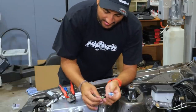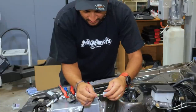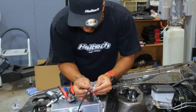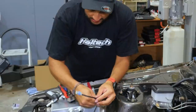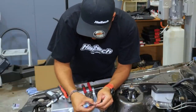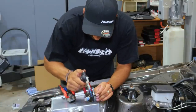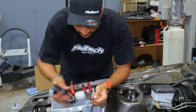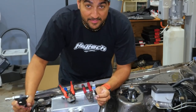Pull that back through - there are little fins on these pins. We're just going to flip them around so they go into those two little slots. We'll do the ground one first - click. You're going to hear a really really faint click when you do it. Both are seated. Push that rubber seal back up - it's got a little bit of a twist on it, just gently caress that back in. Pull the heat shrink back up to position and give it a quick hit with the torch. There we have it - a beautifully crimped, ready-to-go air temp sensor.